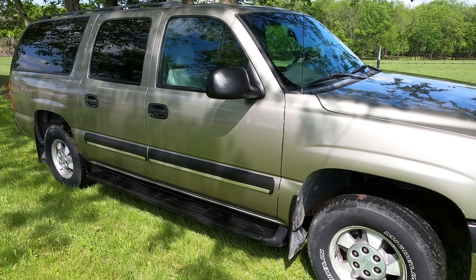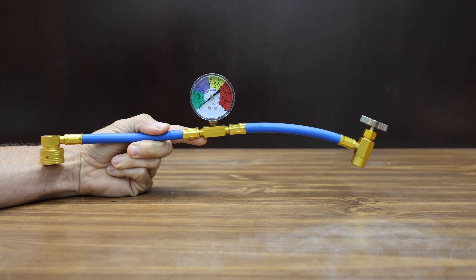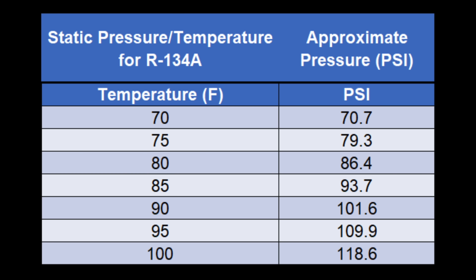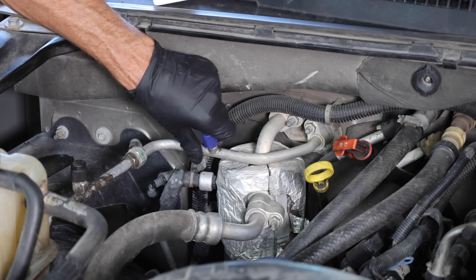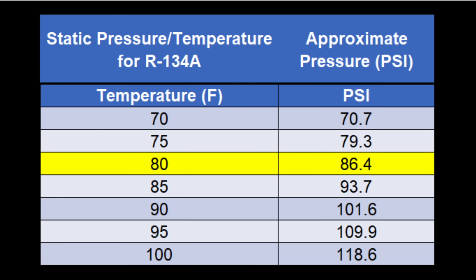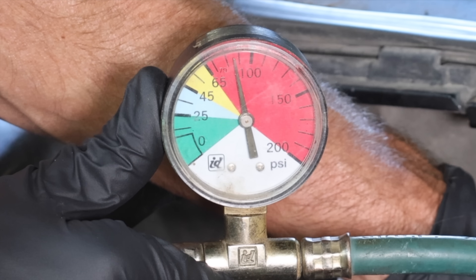This 2003 Chevrolet's air conditioning system is fully charged with Supertech R134A. If you don't have a set of gauges, you only need a low pressure gauge to determine if your car's AC system is at the proper pressure. The car's AC system does have to be at rest and cooled off to the same temperature as the outside air. Let's establish our baseline performance before we test out the fake stuff. The ambient temperature is just below 80 degrees Fahrenheit, so the static pressure of a fully charged system should be around 84 to 85 PSI, and the system is reading 85 to 86 PSI.